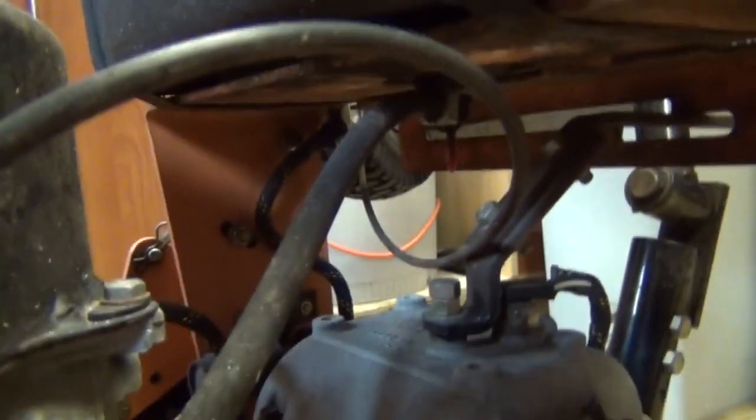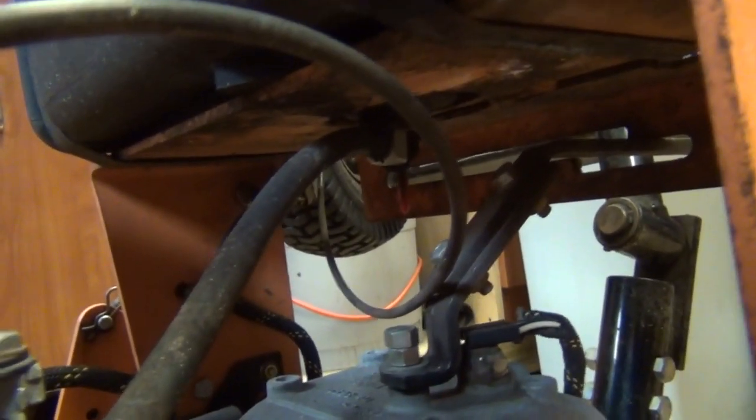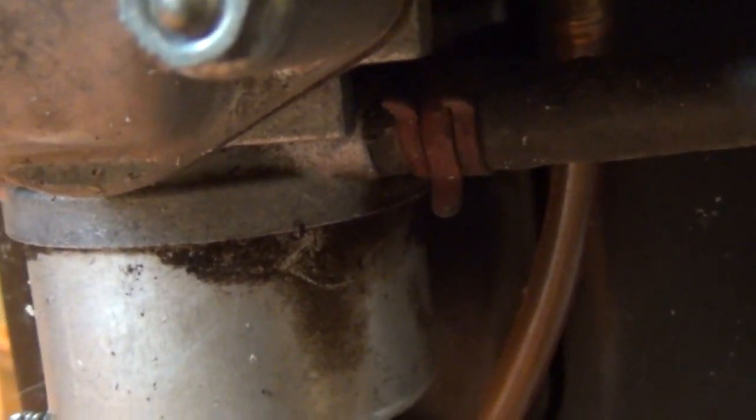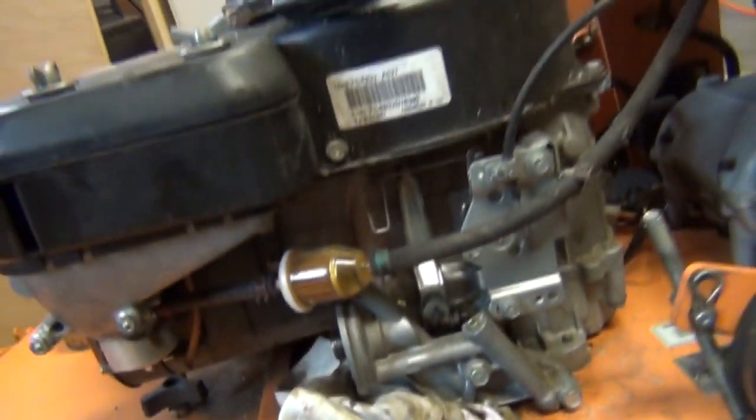Alright, if you have a tank of gas, what you're going to want to do is, underneath the tank here is a shutoff, which is this guy right here, if you can see it. Alright, and what you're going to go ahead and do is just turn that like that, and that'll stop the flow of fuel from the tank down the hose to the filter here. Now all it's a matter of doing is there is a little cinch clamp right there. It's not going to focus, but there's one right there. You obviously have one on the fuel filter there on this side, and there's another one on the inlet port of the carburetor, which is right there. We're going to go ahead and squeeze those and pull this line out. Now we're going to get some fuel coming out, obviously. Just have your old rag ready to catch it.